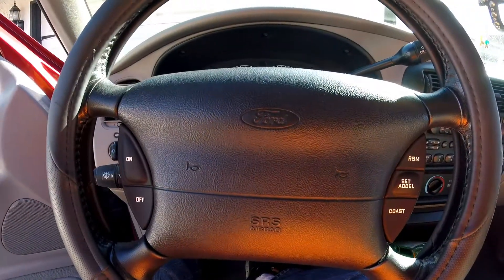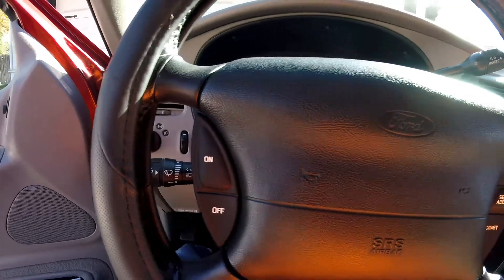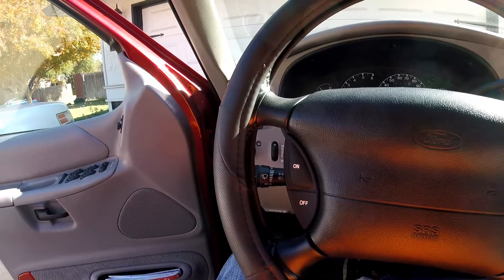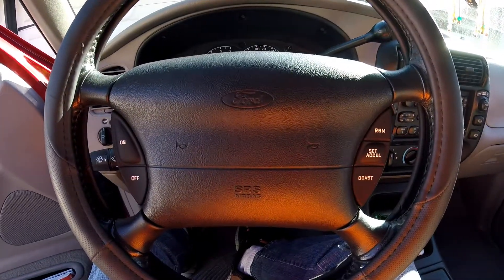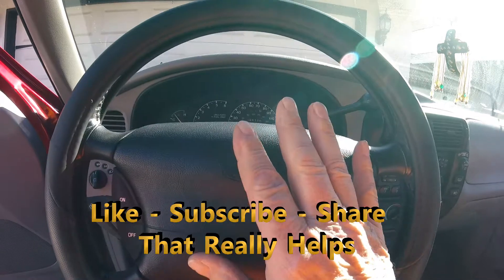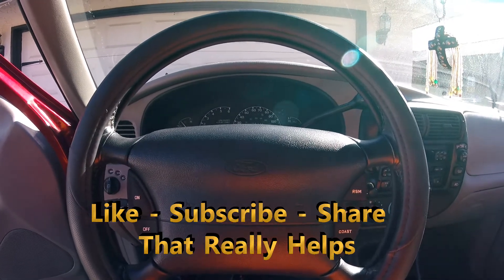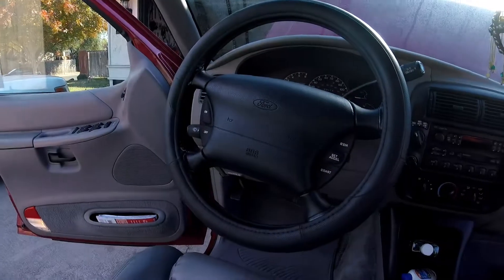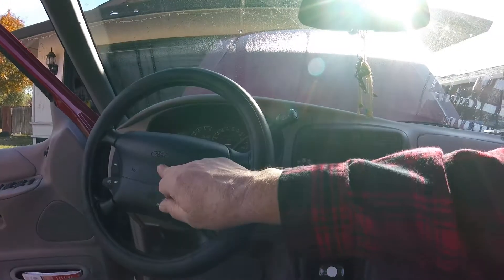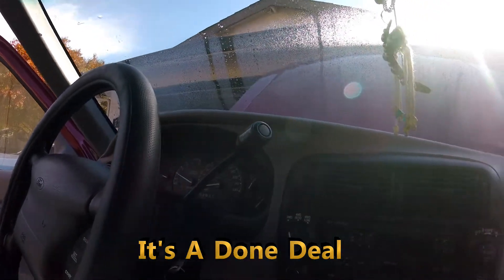I had to quit filming and use both hands when I went to put the airbag in because I had to be exactly precise. But I got it all buttoned back up — all of our switches are completely new. Fairly simple job, probably took me about 20 minutes total. Now, you would think you're done and can just put the key in and start the car — not so fast. When you've got everything back together and the battery reconnected, you don't sit there and put the key in while you're in front of the wheel, in case something's wrong and it blows up in your face. You always get off to the side, stick it in, turn it, and make sure everything works.